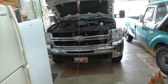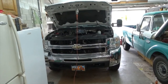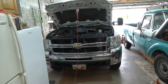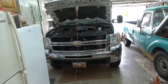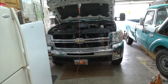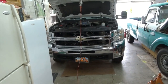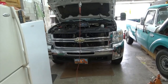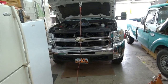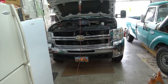Anyway, that's my video, servicing a 2008 Duramax, lot to it. They cost a lot of money to own and to maintain, but if you maintain them and change the oil, I change my oil anywhere from 3,000 to 4,000 miles. I never go to where the truck says it's time. Fuel filter's the same way. Regardless of what the dashboard says, the percentage of the fuel filter, I change it once a year, if not more. The spin-on filter for the transmission, I change that every oil change. The transmission I do once a year. The interior filter. Rotate the tires every other oil change. So it's just maintenance. These people that just drive them until they break, those are the ones that cost a lot to fix. But anyway, been servicing the 2008 Duramax.